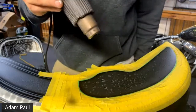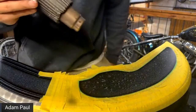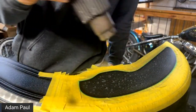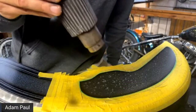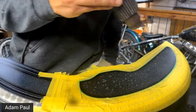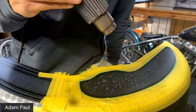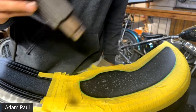They'll do a lot of other funky stuff because they're made to be high build, and that's what everybody's looking for. You want high build, you want to do everything in one coat, because that's the way painters do it, because that's the way you make money. But you don't want that. You don't want to trap all that high build and all those solvents in between all these coats. The U-Pol is thin enough that it evaporates and it allows you to recoat over and over again.